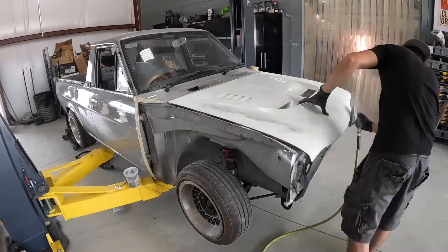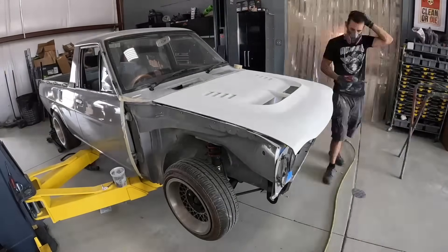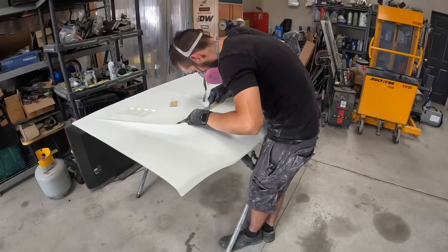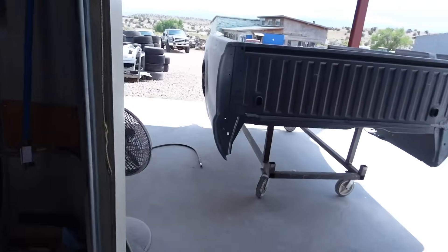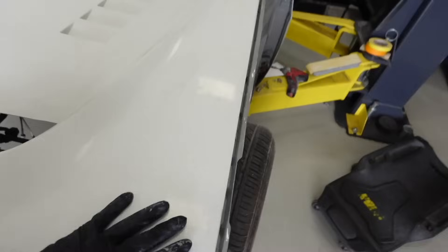Same thing with the hood. The goal is to get this thing in primer. It seems pretty straight as it is - didn't really block it very much, I figured I would do that in the first prime. There's a little crack that I'm kind of fiddling with. The bed was primed previously and the guys got there early in the morning, so this is the next day. They got the bed and the hood all blocked out. Now it is time to mess with the hood on this thing and get it ready for primer.